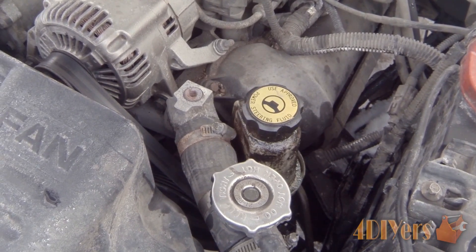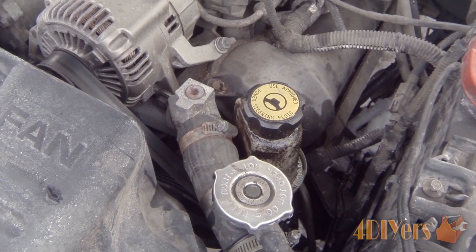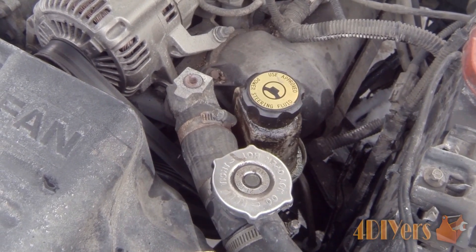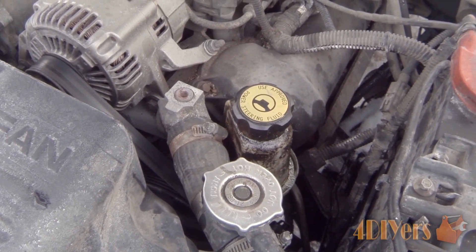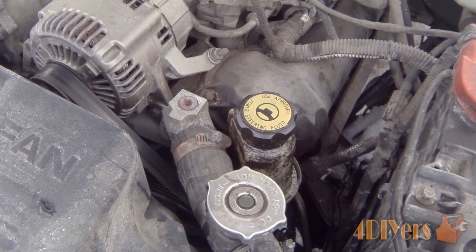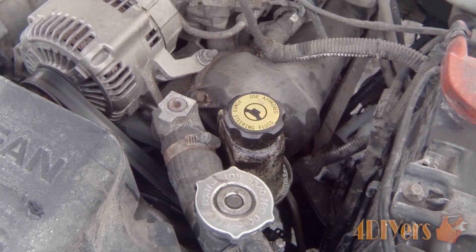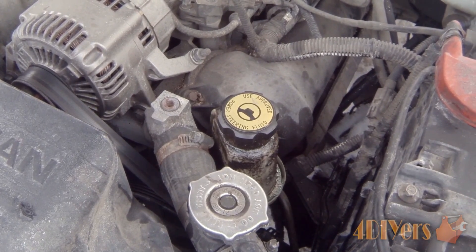Then finally we have the steering rack or steering box, depending on your vehicle's design. All these parts can fail throughout the system and you will notice a lot of different things. If you are noticing you are low on fluid, there can be a leak in the system — it may be minor or more severe. This could be the pump leaking, maybe the main seal in the front, or where the lines are. These hydraulic lines can leak as well; they wear out over time because they are made of rubber, and they do have seals where they bolt into place. You can also find your steering rack leaking.